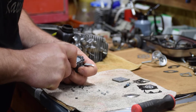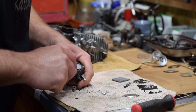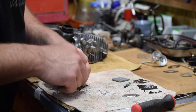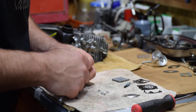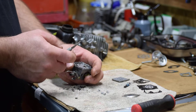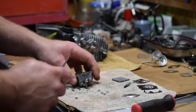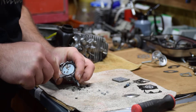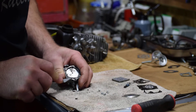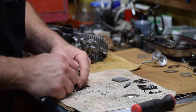We have to get all this black gasket off here because the new gasket won't seal up against it. You never want to use silicone or Permatex — gasoline will attack that. There are some better products out there. I like to use Yamabond, which we got turned on to several years ago racing bikes. I believe it's actually made by 3-Bond. It's a very good product — you can seal your case halves up with it. That's what Yamaha uses to seal their cases.